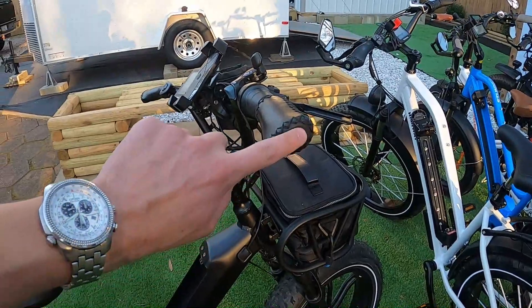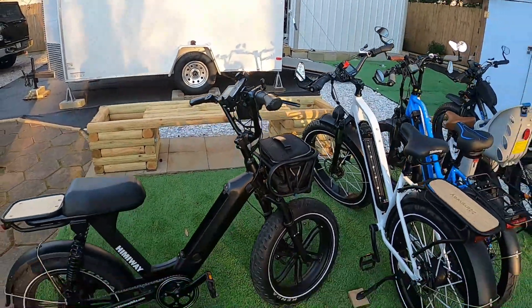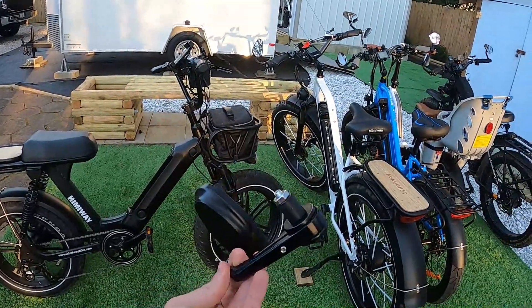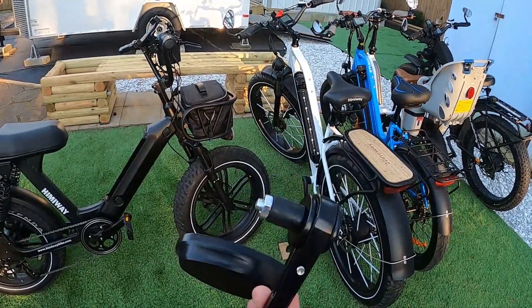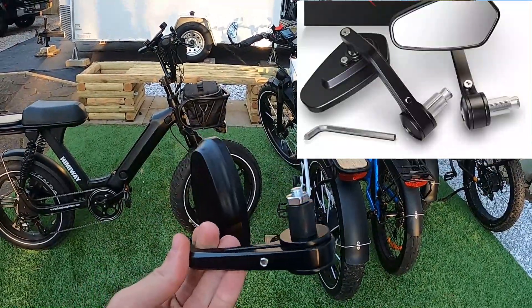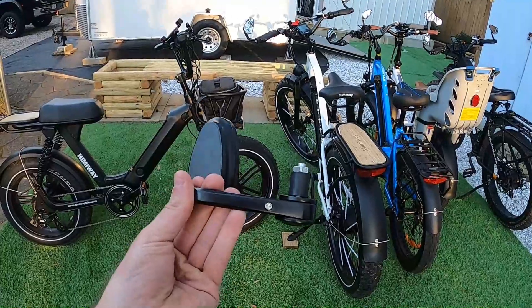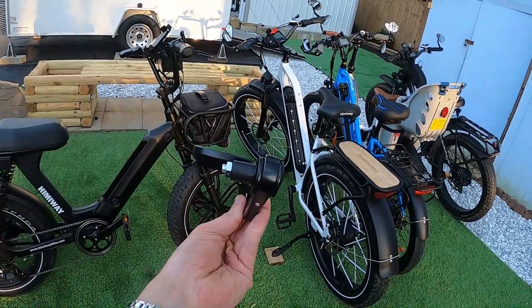On the escape bike, the faux leather wrap goes all the way around with no cap in the bar end, so you have to remove a hole out of there to put the bar end mirror in. Here's what they look like — I'll link them in the description. The very important piece of information is that right there: if you're going to buy these mirrors, make sure you get the rubber insert that goes inside the bar. The last time I did this video I linked the mirrors and then the company changed the product to aluminum and they just didn't work and didn't fit. So make sure when you order bar end mirrors you get the rubber insert.